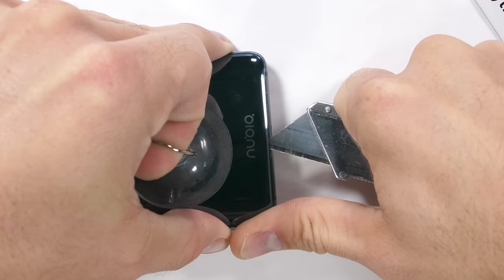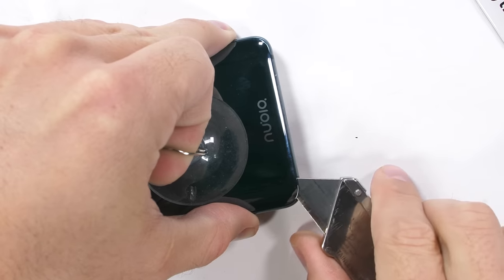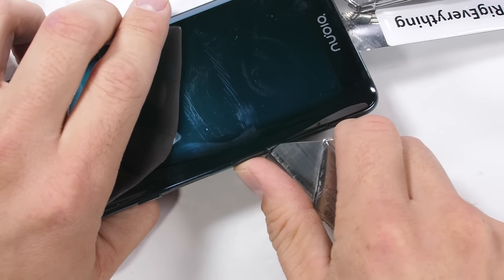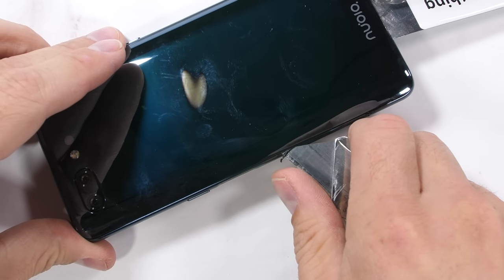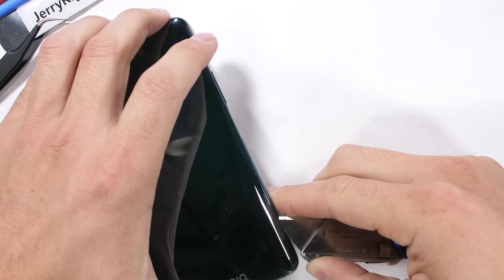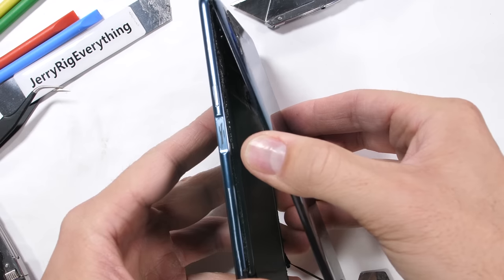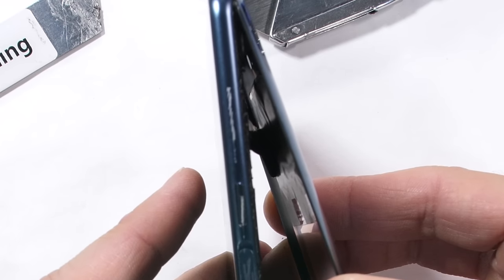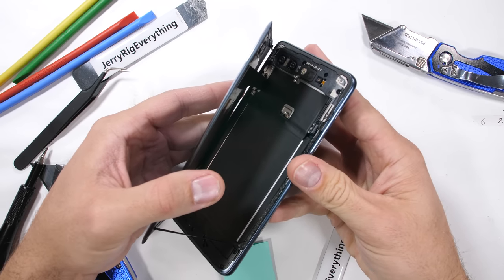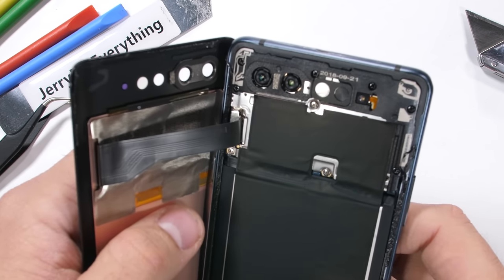The heat softens the adhesive and allows my razor blade to slip in and slice through the black sticky stuff holding the phone halves together. If my metal pry tool or razor blade gets too deep though, I might end up damaging some of the sensitive ribbons – the battery or the rear screen this time around. Since I have no idea what I'm in for, I'm going pretty slow and being super careful. After a little gap is created, I can tell that the screen ribbon cable is up along the top, and I can fold the back glass away from the phone without putting any stress on the fragile ribbons. They can tear like paper.